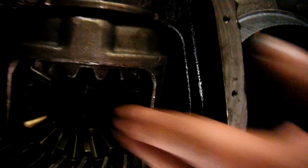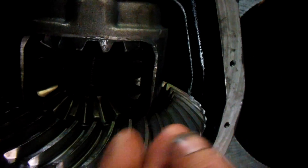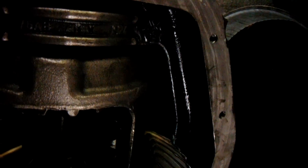You can see my little homemade tool right there to compress these two. I had to bottom this thing out to get them in enough to where the little washers would come off, and even then I had to take one and kind of pound it back in place. Not only that, you have to either hold here or there while your friend with the longest breaker bar in the world overcomes the spring pressure to walk these guys back in.